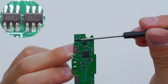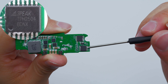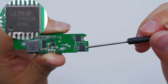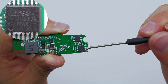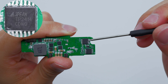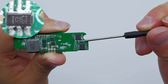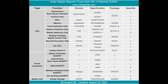The analog switch IC is from Texas Instruments and adopts SC70 package. The quad op-amp is from 3Peak and adopts TSSOP14 package, with 100 mA high output current capability and rail-to-rail input and output support. Another quad op-amp also from 3Peak in TSSOP14 package has an output current of 70 mA. A second analog switch IC between the two op-amps is also from Texas Instruments.